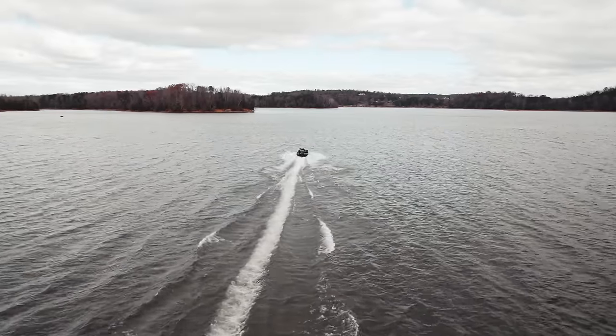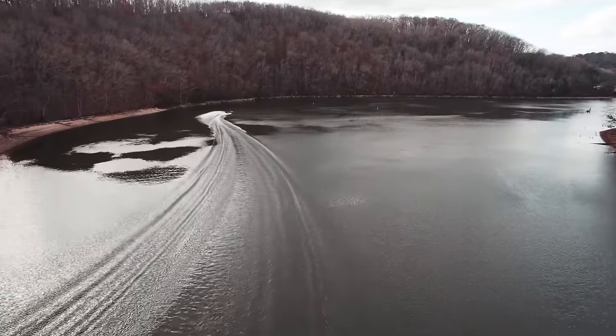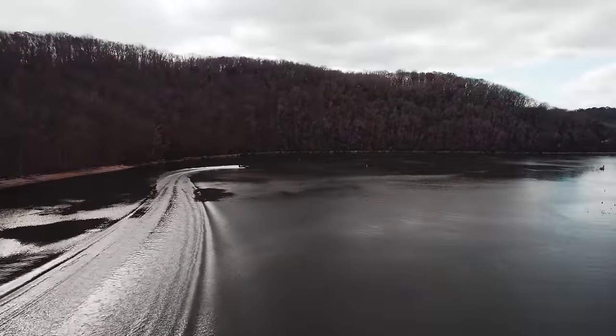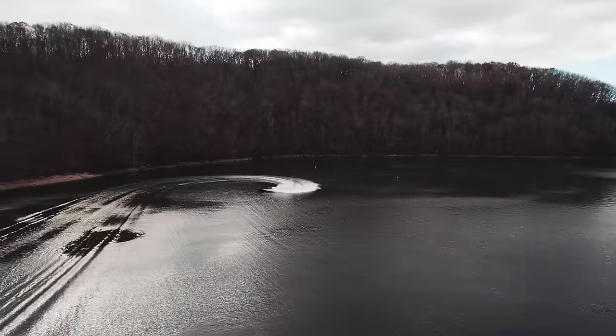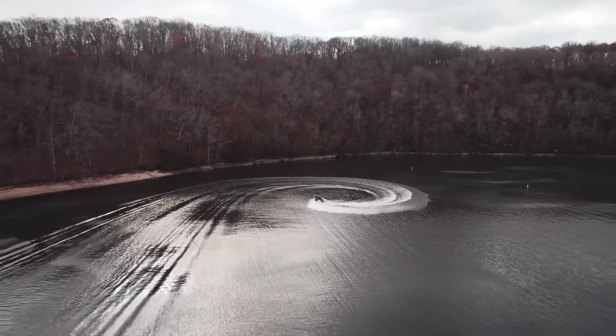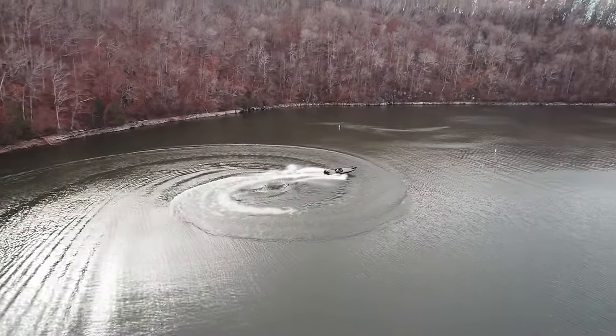I do have basically 29 gallons of fuel in the boat, so full tank is 50 gallons, 20 gallons there. If you add a Marshall in, but I do have all my tackle, everything loaded, what would be considered for a tournament day. And the one thing I'm probably gonna do is test out some Bob's Machine Shop 2-degree wedges. What that's gonna do is allow me to trim the engine up a little bit more. I've done it on boats in the past. It just gives you a little bit higher RPM, allows you to trim it up a little bit more.